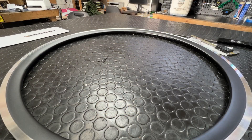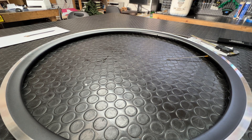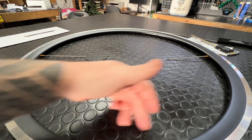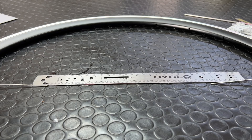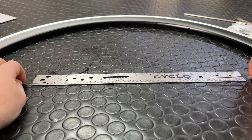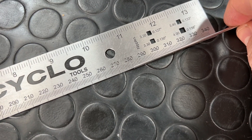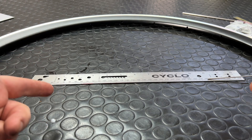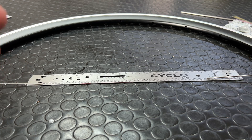Using ERD sticks is a simple task. Take one of your ERD sticks and place it in the spoke hole above or below the valve hole of the rim. You then need to find the join of the rim and place the other stick in the inverse to that. Perform a check to make sure you have the same number of spoke holes to confirm your ERD sticks are at 180 degrees to each other. Then take a quality steel rule, line the end of one ERD stick up with zero, and take a measurement across. In this case I'm seeing a reading of 280mm. You add the length of each ERD stick — mine are 150mm each, combining to make 300 — plus my 280mm means this rim has an ERD of 580mm.